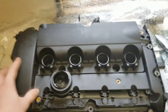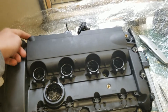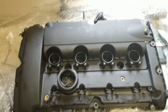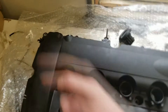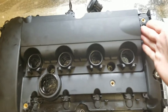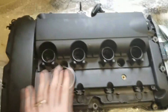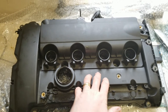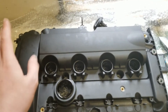The issue I had with this one is that at idle, this side should be sucking air into the intake manifold, which is under vacuum. But this side had air coming into it as well, which it shouldn't — this side should be closed off when this side is sucking. At idle, if I took the pipe off here and put my hand on there, I could feel it sucking air in, which is just going in here and out there. So not only would there not be much of a vacuum on the actual engine, it also means I was getting unmetered air into the engine, which the ECU complained about.